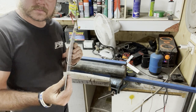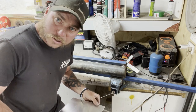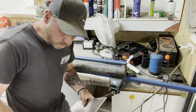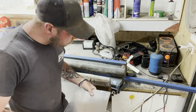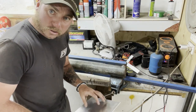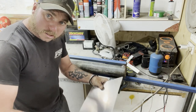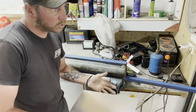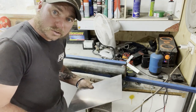It starts to put a radius on it. You're probably thinking that's not a very big radius - well, that's fine because we don't need a big radius, but you've got to bend metal gradually. Don't bend it all at once, otherwise you end up with hairline fractures in it. Just knead it a little bit and keep going. Especially with aluminium, if you're not heating it up you will get hairline cracks and lose all structural integrity. So just knead it gradually, get it to the shape you want bit by bit, and you don't go over the top.